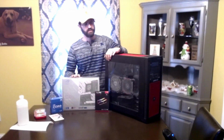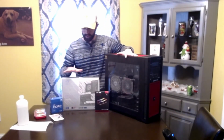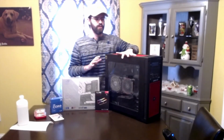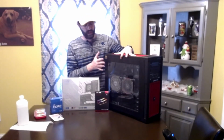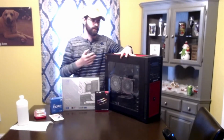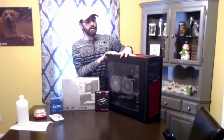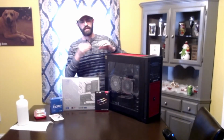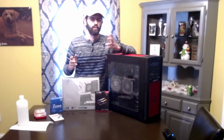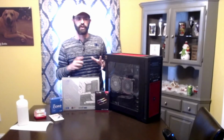Now, some other things to watch out for is you need to make sure that before you start messing with any computer internals, whether they're new parts or something that's already in there, you're grounded. They make mats for that. I typically just make sure that when I touch metal that I'm already grounded before I touch something else, to make sure there's no electrical spark there. Other thing is, I suggest if you have a metal ring, take it off. Even if you have a silicone ring, anytime I'm doing work like this, I always suggest just taking it off. That way you don't catch it on something and snag or break apart.